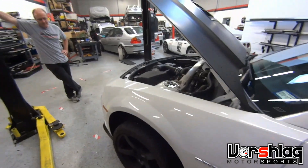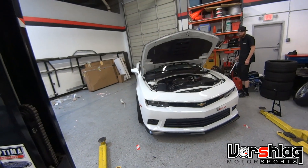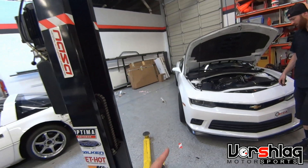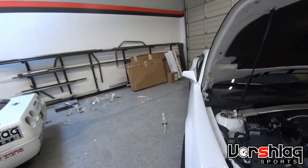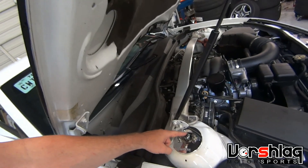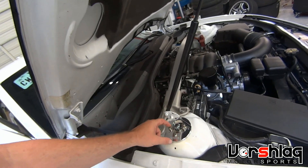It's just off the ground enough so that once you loosen these nuts, it can slide in and out. Dropping it down. We got about three and a half degrees of negative camber on stock suspension, and you go any more than that and things start running into each other. There's still more inboard travel at that camber setting, but the OEM perch and OEM spring are bigger and they physically run out of room in the tower and start running into things.